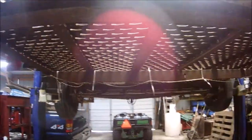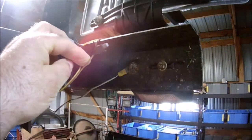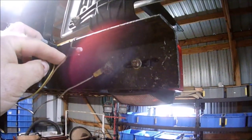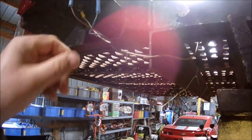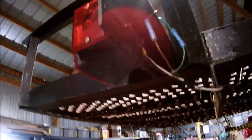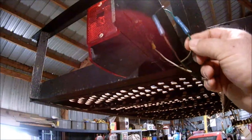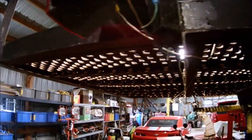For those of you that don't know about the wiring: the brown wire is your taillight — that comes on both left and right sides. The yellow is your left turn and brake light. Over here on the right side, again the brown is your taillight, and the green wire is your right turn and brake light.